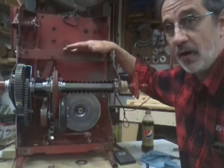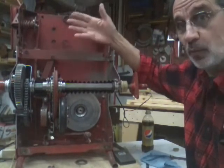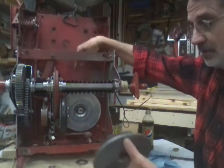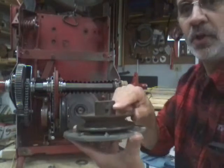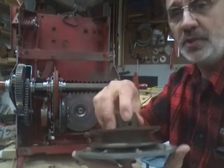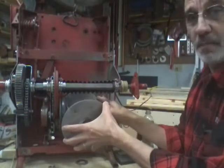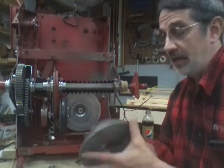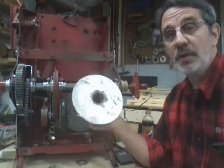If you look, I have the mower deck off — it's pretty stripped down — but if your mower deck was on it would be hanging right about in here in your way. If you look down on the top side of this drive disc, it sits in here like this. You're going to see two set screws that go through the hub. These two have been removed, but this hub is fitting in this model just like this. Loosen those two screws and this hub will slide up and down on the crank on the engine.